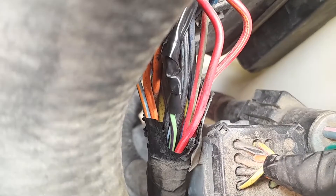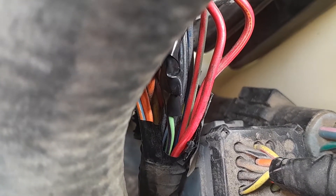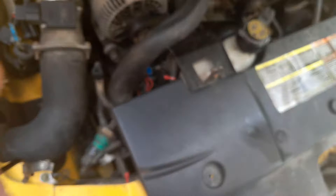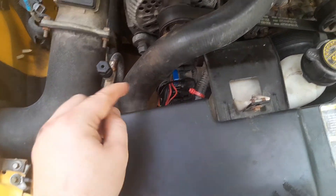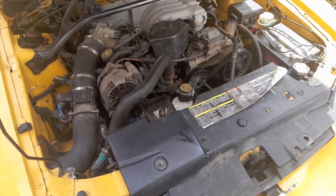Now if you need a quick fix, the easiest and cheapest way to do it on this specific car — the 5-liter models, not the 4.6s, you'd have to use a different wire — is pin 17. There's a green wire with a purple stripe. You want to go ahead and cut it and crimp, solder, whatever you want, but you need to take that green wire with the purple stripe and ground it. What I did on mine is I shaved it off, looped wire around it, soldered it, wrapped tape around it, and then ran it over here and grounded it to this factory ground location.